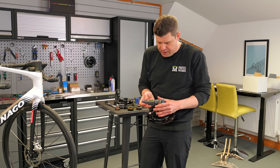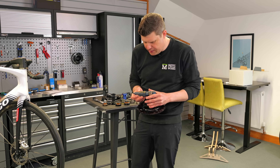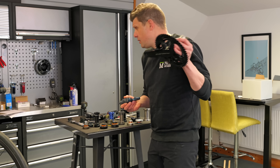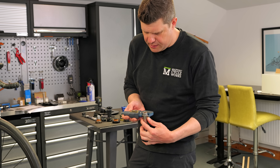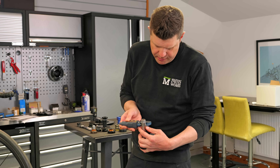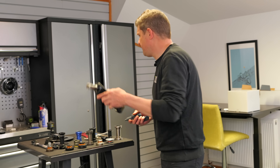These are pretty hard to measure — you need to find a consistent place. This should be just a smidge under 24mm. The Shimano is at 23.98mm — perfect, that's what it should be. The Seabree ones measure at 23.94mm. I also noticed a little bit of a taper on these because right at the bottom, we're actually at 24mm dead. That explains why this is a tight fit.